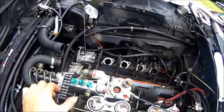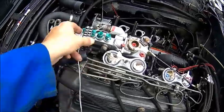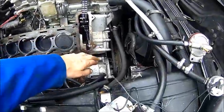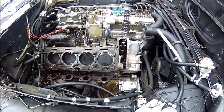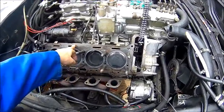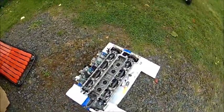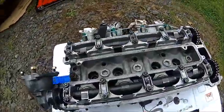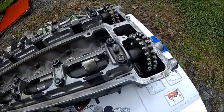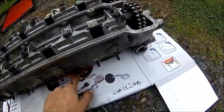We got the head busted off. Obviously before you pull the head, secure the ends of your chain — it's a split chain. You've got to secure it, otherwise it goes down and you can't find it anymore. It was leaking here, and I think it was leaking here as well. Oil.